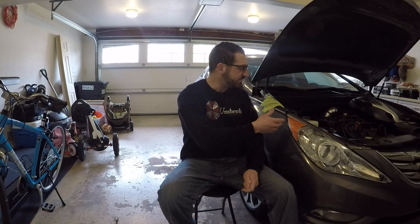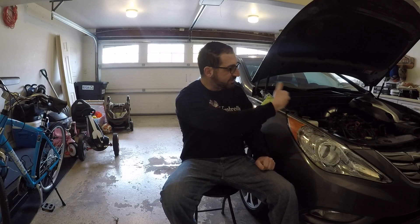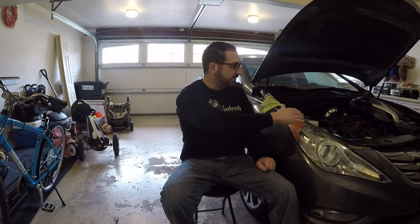Maintenance is a big thing with turbos. You need synthetic oil, of course. This car used regular oil at the beginning, but synthetic oil is better since turbo cars run a little hotter. You want to keep the oil a little cleaner. In this case, you'll have residue from the PCV system going back into the intake.